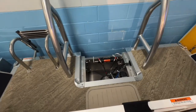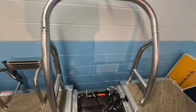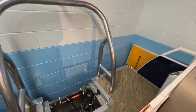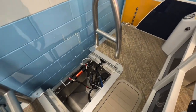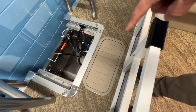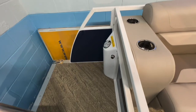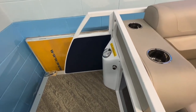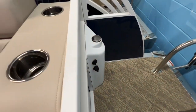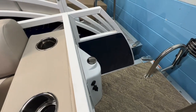This is rated for up to a 200 horsepower engine. We don't pre-mount an engine because if someone wants a 150 or 200 — our most popular engines — it allows us the flexibility to change with the boat we have in stock. You have in-floor access to the fuel tank fitting, so you don't have to tear up the floor to get at it. You've got your gas fill on this side, 12-volt charging ports so you can inflate a tube back here on the back deck, and a plug-in for your light pole.